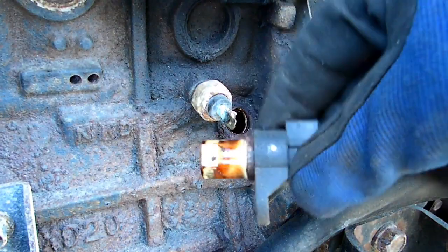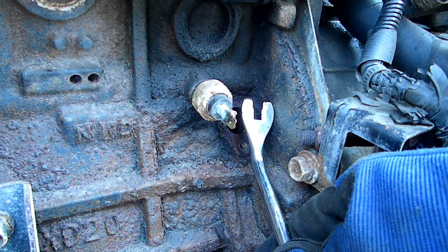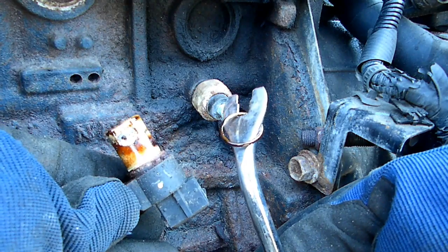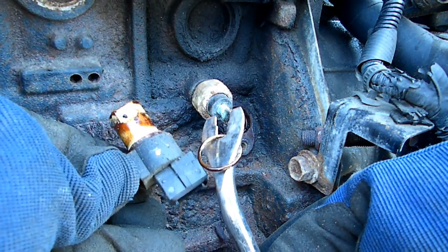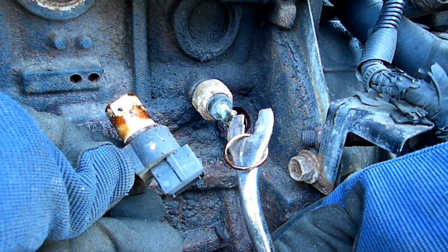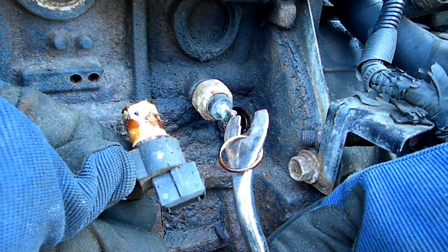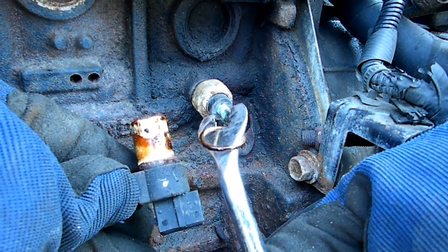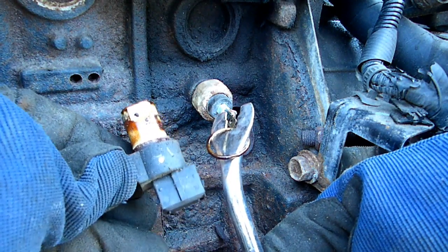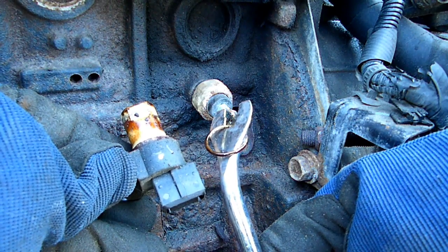You can see that the O-ring is in the block right here — the O-ring popped off of the crank sensor. So that's all there is to removing the sensor. All we have to do is reverse our steps, lubricate the O-ring on our new sensor, and we will have replaced our crankshaft position sensor on our Hyundai Elantra.